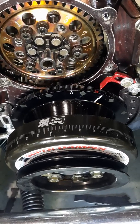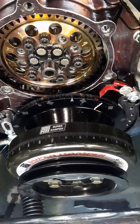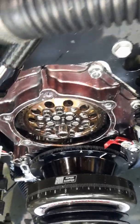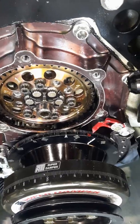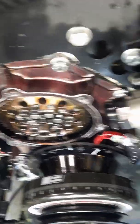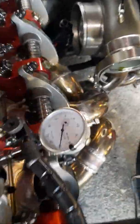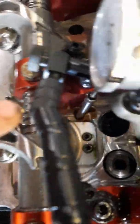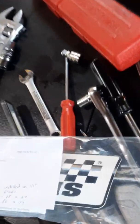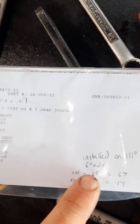On the engine stand, I like to use Bullet Cam's method — it finds the intake centerline at a set value of intake lift halfway in between, which is the maximum center of your intake lobe. But for ease of sake in the car, this happens to be 25 degrees before top dead center at 50 thousandths lift. I've got a pushrod with some cardboard to keep it semi-straight. Mine happens to be about 6 degrees advanced — here are my marks.